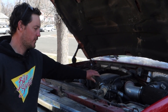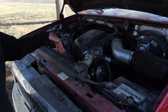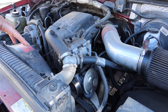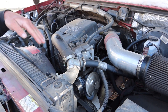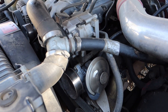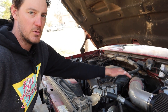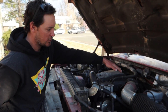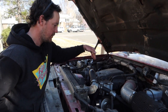Mostly all we need to do for this vehicle is just heat it up as much as possible. So this is the radiator. Once the truck hits temp, the thermostat turns on and the water pump pumps hot water through the system to cool down the motor. Your radiator is just full of water with antifreeze so it doesn't freeze and break the radiator. I've teed into the radiator here — as the water comes out, it goes out of the motor bay along the aluminum fuel lines under the waste vegetable tank that's full of filtered vegetable oil, and then the slightly cooled water comes back in under the radiator to go back through and cool the motor as well.